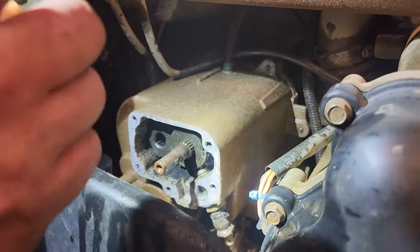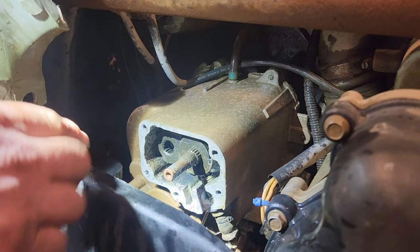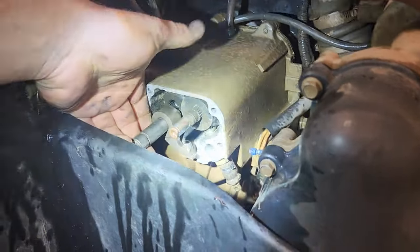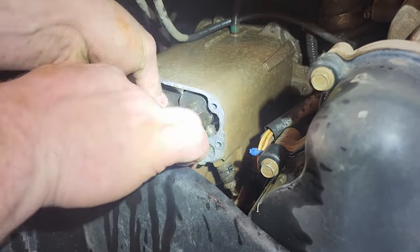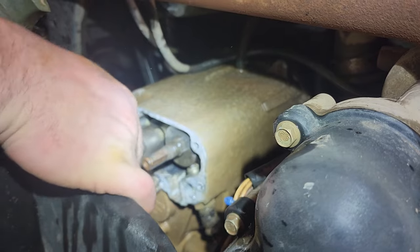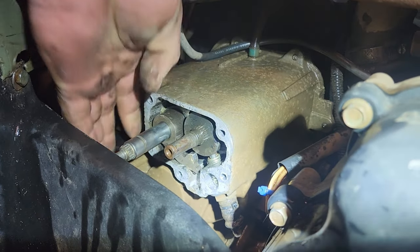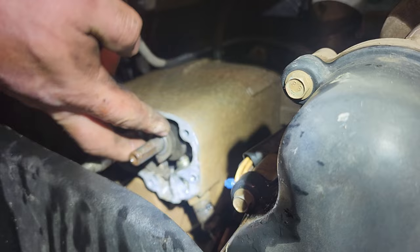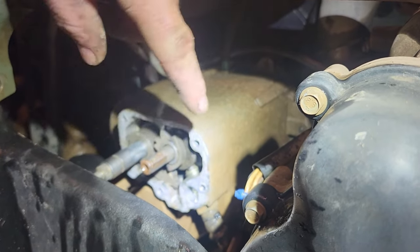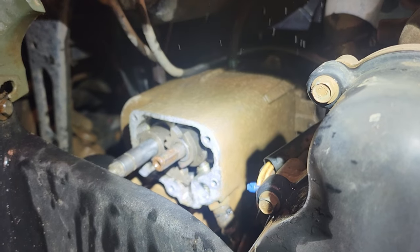So, okay, we got the cap off. There was a lot of mud in here. I've already kind of blown it out and sprayed it out with water. So there's two shafts here. There's this guy that sits over here with the pawl on it. I should have put this in before I did this. Well, don't tell me this thing's sectored. It is. Goddamn it. There we go. Spit on it, she'll go. Okay, so that sits in there like that. This guy sits in here somehow. It's clocked a certain way, I'm sure. Maybe with any luck, it's sectored as well, but you get the idea. There's a spring that sits under here. This locks on here, and that tells you when you're in gear. So we got those out.